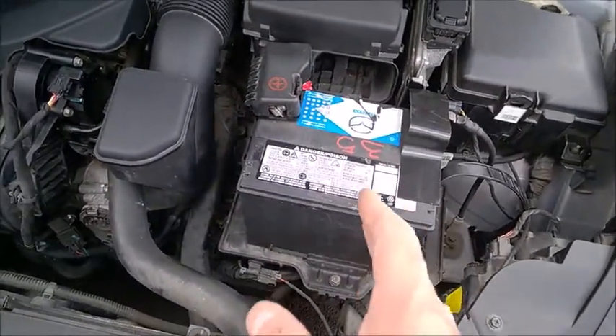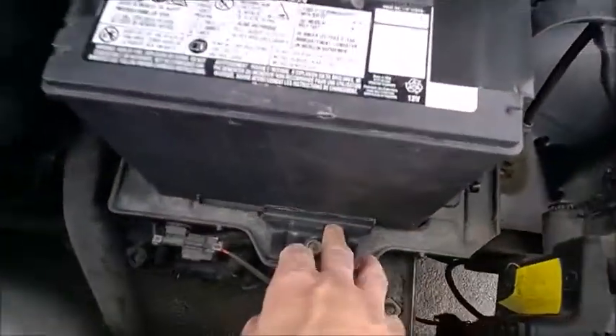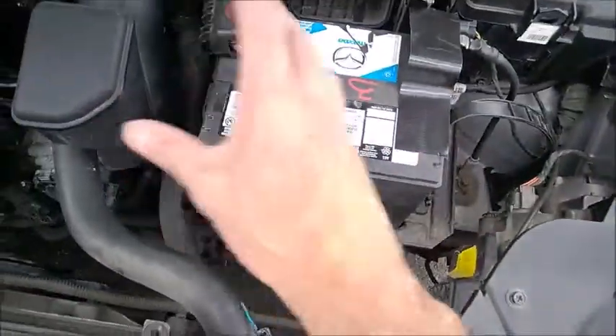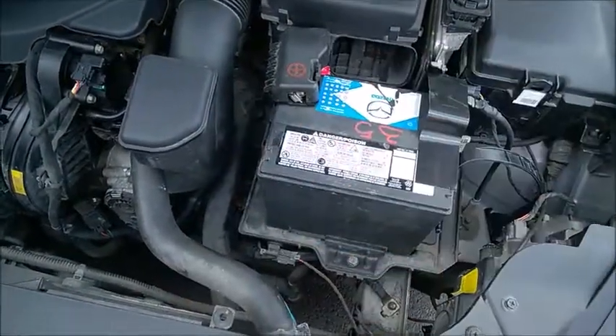So you can replace to an acid lead battery — you need to find one that fits inside the tray and make sure you secure it properly. You don't want the battery to flip around or move to one side; in a small crash that could cause a fire.